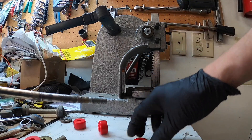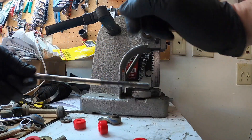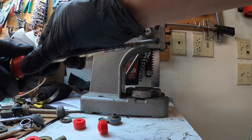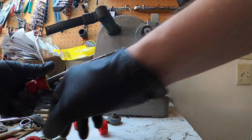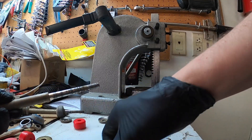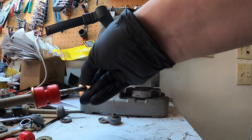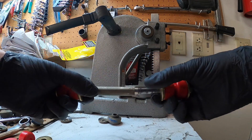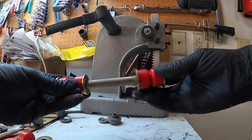Since the Kryptonites did not work out, Guy just replaces the bushings once more. Guy has seen a variety of ways people stack these up. This is the correct way. The LCA and the sway bar end go in between the bushings, nowhere else.